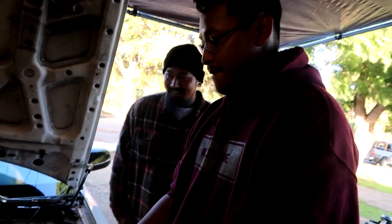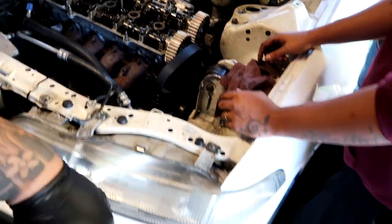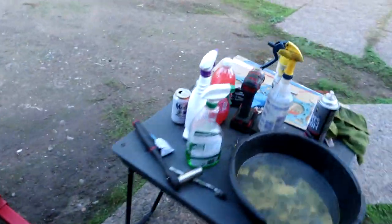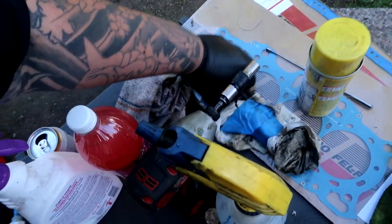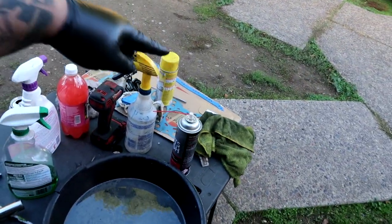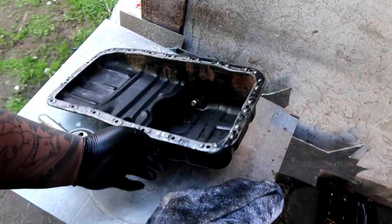This motor we're going to try to pull out, swap everything we need, and slap it on there. I just so happen to have a set of LS and B20 ARPs from my last setup in the CRX, so we're going to slap those on as well. I'm doing the oil pan gasket, and the reason is we're swapping out for the old pan because he has a bung on it - he has a Moroso on his new motor.